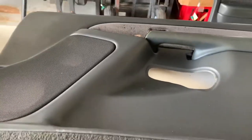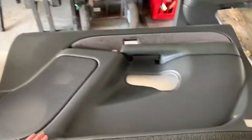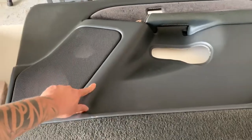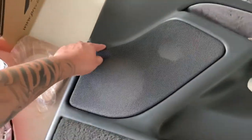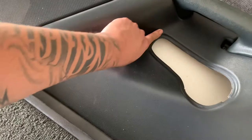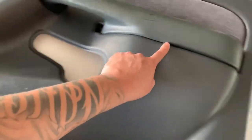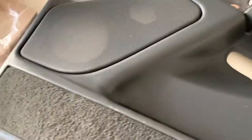So it has a few layers of tape. So then when we go make the mold over, the actual fiberglass does not stick to this part right here. So then we can slide it off, shape it. It's definitely going to take this shape. In my time building door panels, this right here is always a nightmare, but we can make it happen. Ain't nothing that can't be done. Take that whole shape.